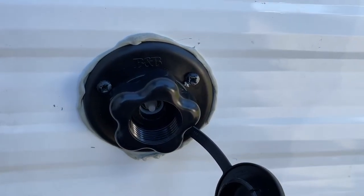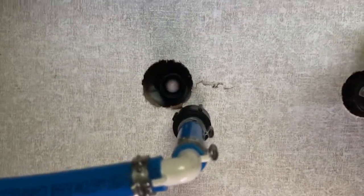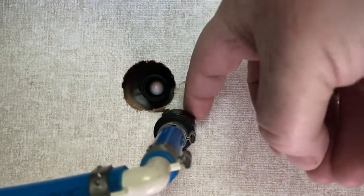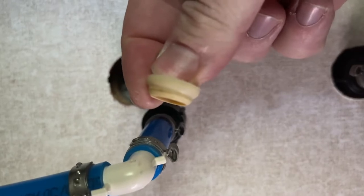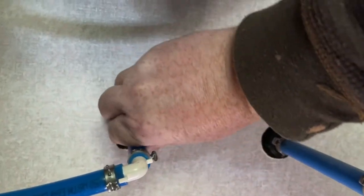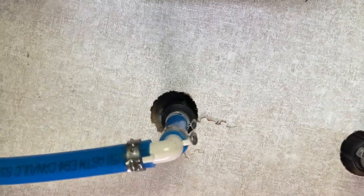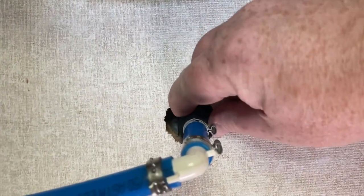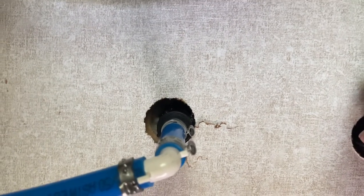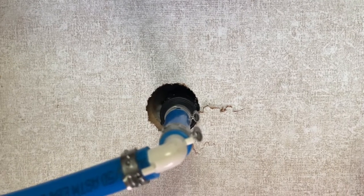Check valve is working. We pop the little filter screen on the front side and that'll be done. Back inside now — we've got our new setup in there, got our old line, got that little compression fitting there. Just going to stick that right on the end, nice and gentle. We put it on by hand since it came off by hand, and then we'll check to make sure there are no leaks. May get the wrench and give it a little quarter-turn just to make sure it's sealed up. That's pretty much it — that's how you replace that.